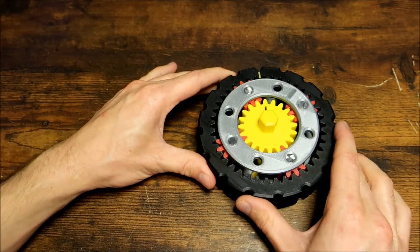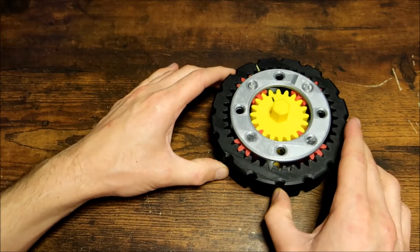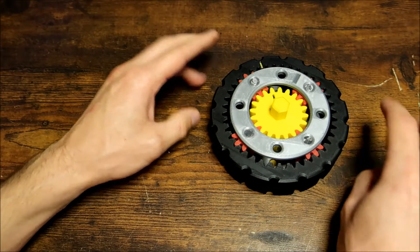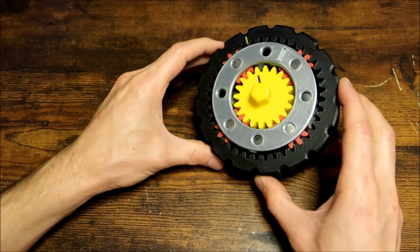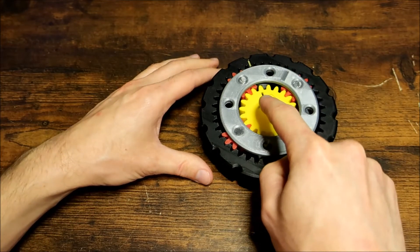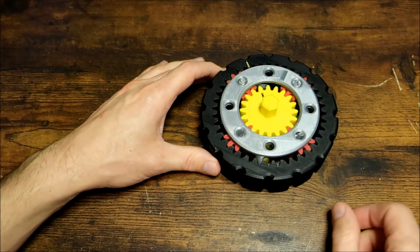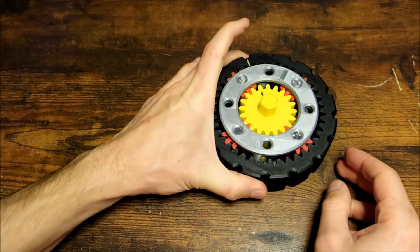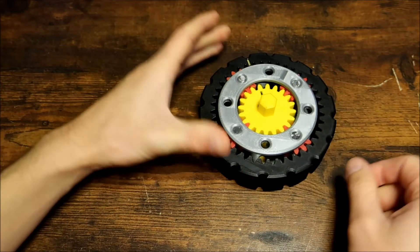So first I'm going to represent a low gear — something like a three to one or four to one gear ratio — a high gear ratio number, but classified as a low gear because you're in like first or second gear. In order for a low gear to be achieved on this, I'm going to use my sun gear as the drive gear. We need to drive a component, but then we also need to hold a component in order for power transfer to occur. So I'm going to hold the ring gear and rotate the sun gear, and let's see what happens.